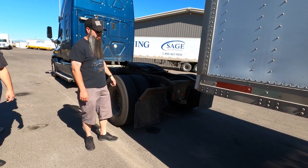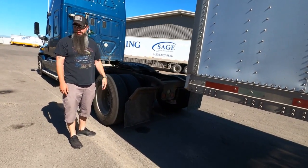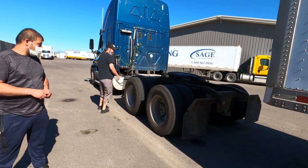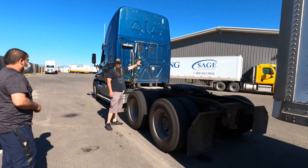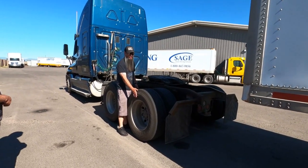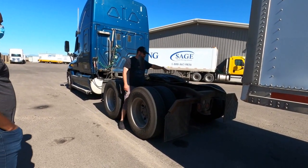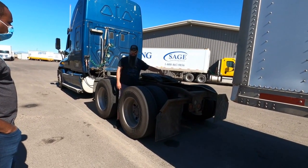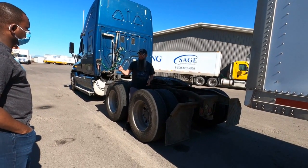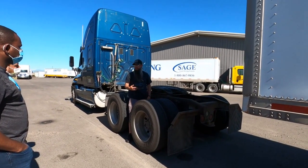You're going to go ahead and back the truck up all the way to the front of the trailer, and then you're going to stop and get out and look, okay? So I'm going to do that real quick. When I'm backing up with a sleeper cab, remember, I don't have the window back there, so I have to use my mirrors. What I'm looking for is to make sure that the edge of my tires is lined up with the edge of my trailer here, okay? And that'll be sufficient. Remember, we've got that V channel here, so it doesn't have to be perfect. As long as that kingpin can get somewhere within this V channel, it'll track itself up there. It's common when you're backing up to see the trailer move to the side a little bit. That's completely normal. You haven't done something wrong.